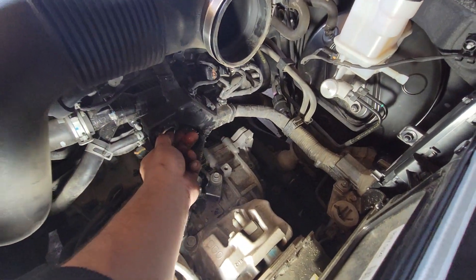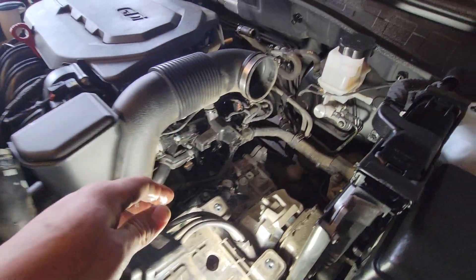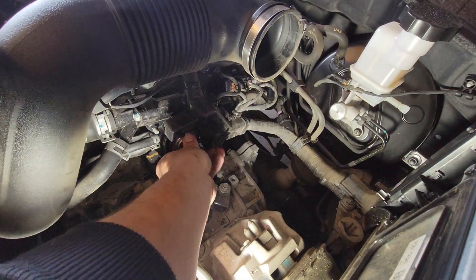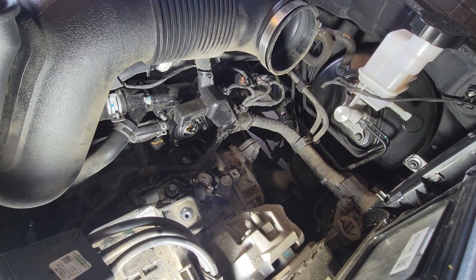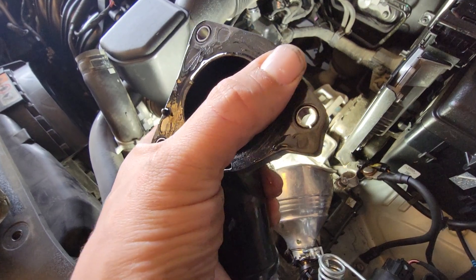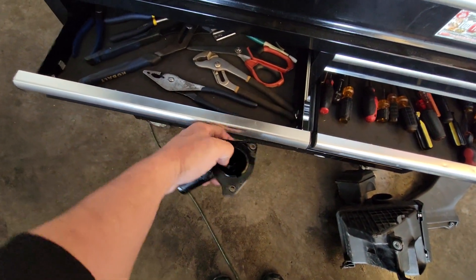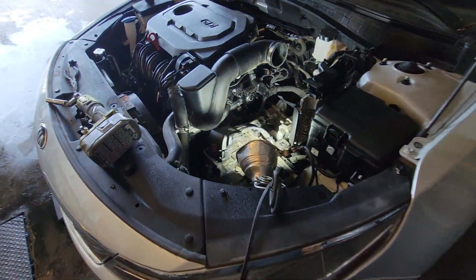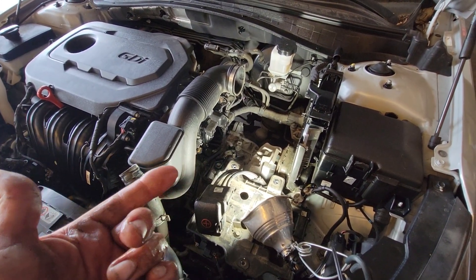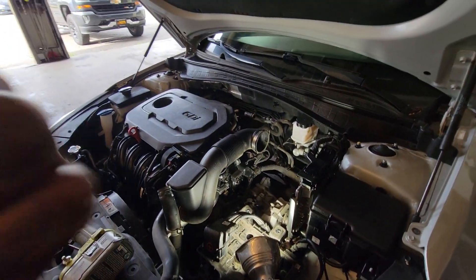We'll set the bolts down and here comes the thermostat — there it is — and there's the coolant draining out. That is how we remove the thermostat on this 2020 Kia Optima. This is a plastic housing. I'll plug that up until I get the new thermostat. The new one will come with a new gasket. I'm going to scuff up the surface with a green Scotch-Brite just to clean it up. Then we'll install the new thermostat, add coolant, burp the system, and we should be good to go. This video is just how to remove the thermostat — stay tuned for the next video on how to install it. Thanks for watching, please like and subscribe.